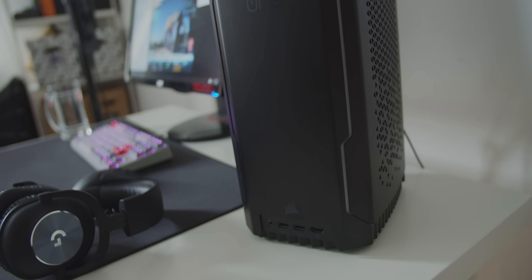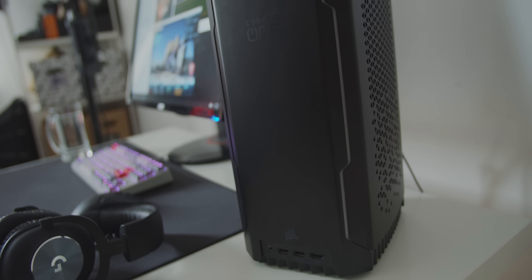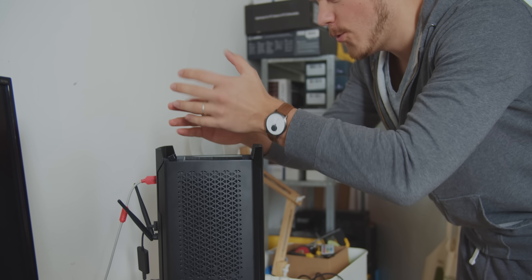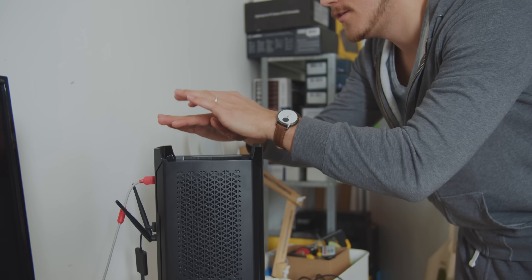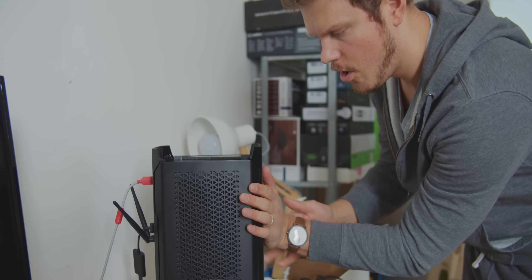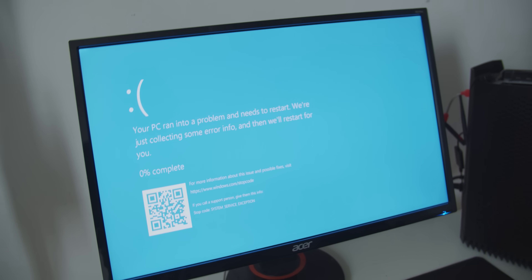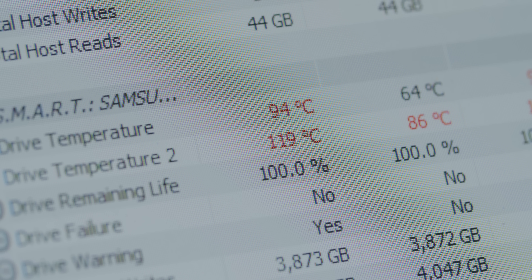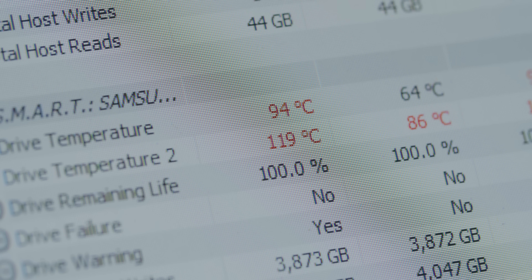I noticed a few weird things: there was a smell — almost like something was melting inside the machine. The front LEDs in the case started flashing red, indicating the system was overheating. The entire front and CPU side were super hot to the touch, and I could literally warm my hands by hovering above the enclosure. I was so excited to plug the fan back in. Around the 26-minute mark the system BSOD'd — which took way longer than expected. Both the SSD and hard drive were super hot, so the shutdown may have been caused by those as well.